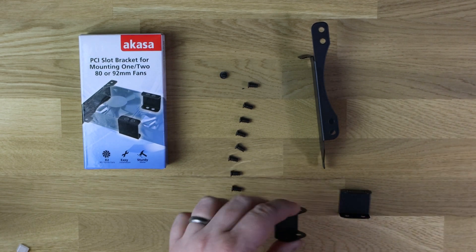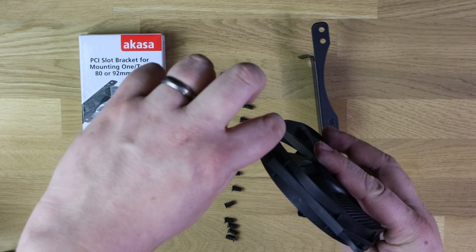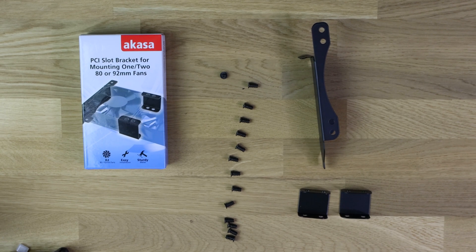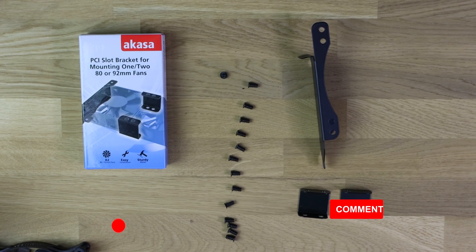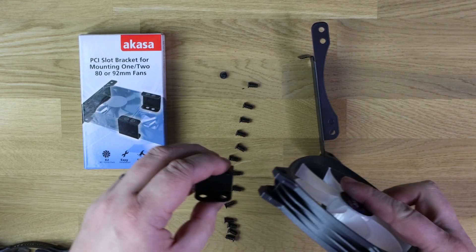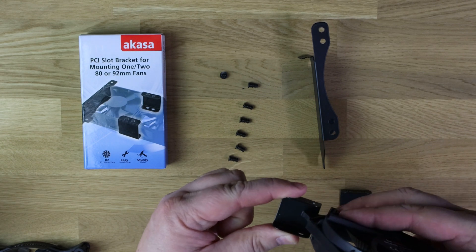As you can see, that just fits in. If you have a fan which is 25mm thick but the fitting brackets on it are really slim and not all the way out, it's not going to work. You need a fan which is standard thickness — basically the fitting is as wide as the fan, and the fan can be no more than 25mm thick. If you're using thin fans, some on the market are as low as 20mm; they won't work either.